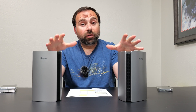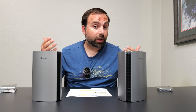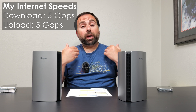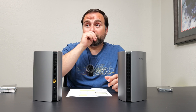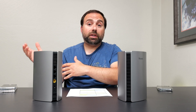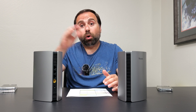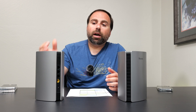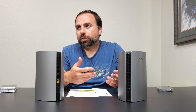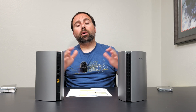The reason longer passwords matter: when switching out your mesh system or router, you can use the same Wi-Fi name (your SSID) and password — both are case-sensitive — and all your devices will automatically connect to the new system without reprogramming everything. Now, internet speed test time. No matter how fast any router or mesh system is, you're limited by your internet speeds. My internet speeds are 5 gigabits upload and download, but this router only has gigabit ports, so it caps speeds to gigabit. Up to gigabit this thing should be solid — I got around 940Mbps, which is typical for a gigabit connection.